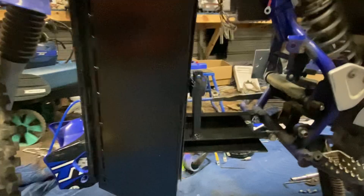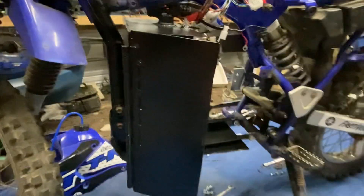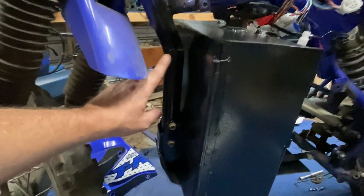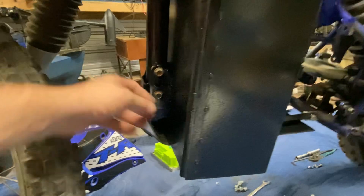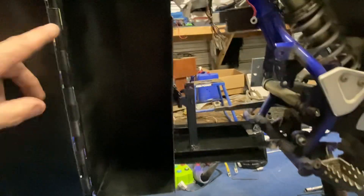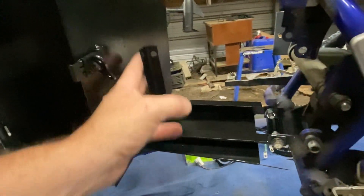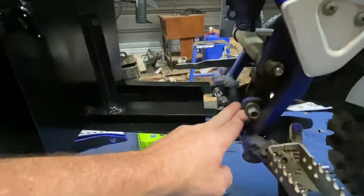So this here is the battery box. This whole battery box is going to take the place of the motor, because the motor used to keep the structural support. I cut the frame right here — I sliced it, didn't slice the back of it, bent it down. I utilized the bracket that was here that used to connect to the motor. I built this box out of scrap metal and a hinge, welded it all together. This is part of my motor mount structural support. This connects to the frame, then goes underneath with this big giant skid plate. The skid plate continues all the way underneath, folds up to the front, and is welded onto this bracket here that bolts on — that strengthens the whole thing up.